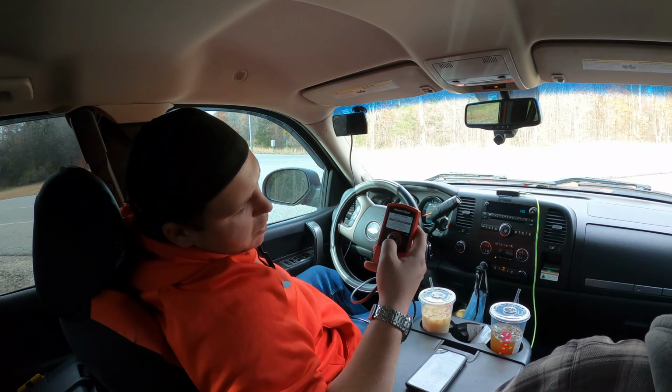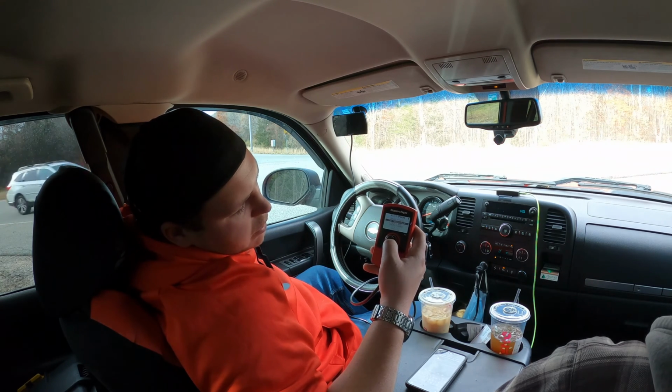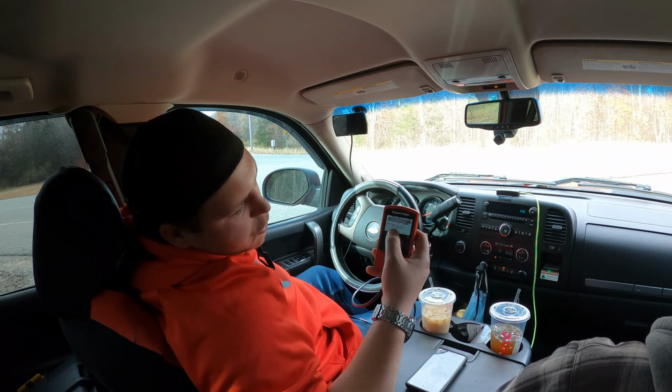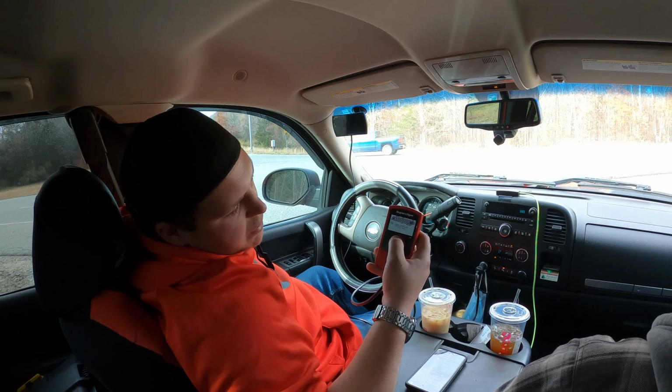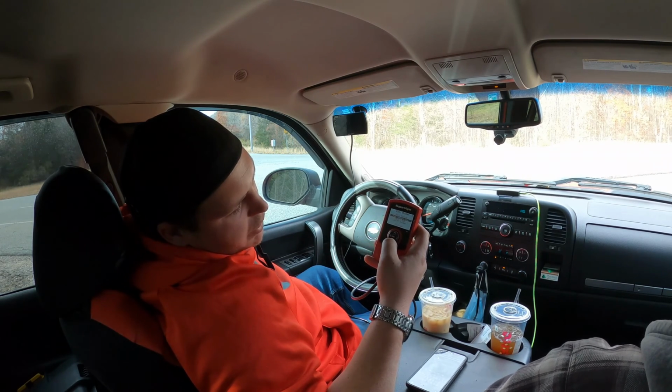Gear ratio, we are stock ratio, we're not gonna worry about the tire size. Shift points, we're gonna set those to the Superchips value. So when you click on it, it says Superchips value, and then you can adjust slightly. We're just gonna leave it at their value because we know it'll work. Fan temperatures, we're gonna leave that at the Superchips value as well. If you have a 180 degree thermostat, it'd be perfect because you can set this for 180 so it's not bouncing around on you. Like I said, we don't, so we're just gonna leave that.